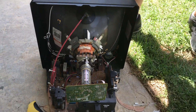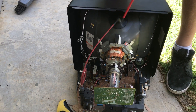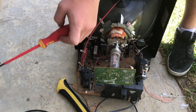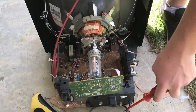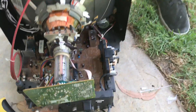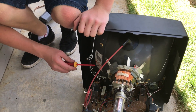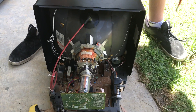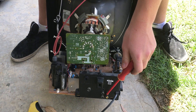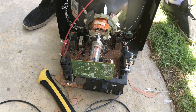Inside the neck is the electron gun, which is used to accelerate the electrons inside. The electrons are accelerated and go to the phosphor screen to produce your picture. Here is the driving neck board. The older ones just had the socket on and had all the stuff down on the main board. This here is your high voltage anode cap, and that there is your high voltage flyback. That is the power supply board. This here is a hot chassis, so here's the power in — that goes to a fuse which I shouldn't touch because there'll be a good bang and sparks will fly.